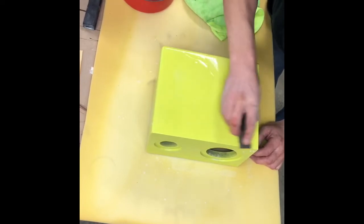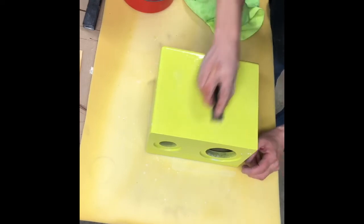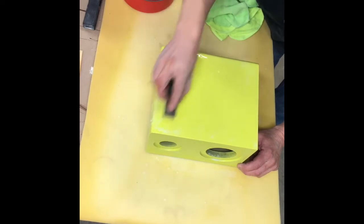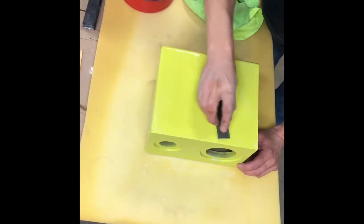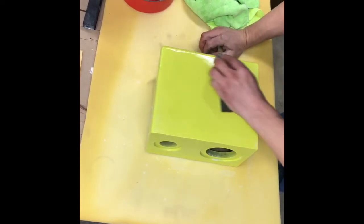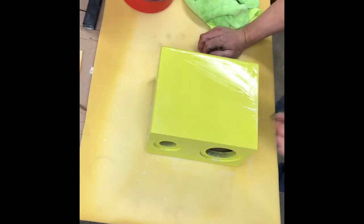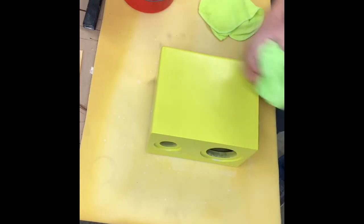As you sand, you can smell the solvents in the clear. So it means there's still a few trapped solvents in there that still come out. Oh, 2,000, you ain't gotta go crazy with. You're just getting out the 1,500. You're done blocking, so that'll be 2,000.